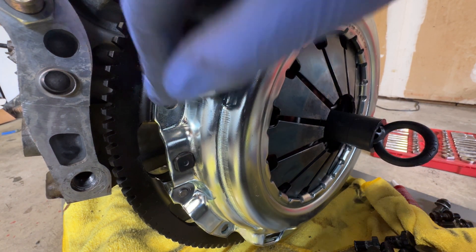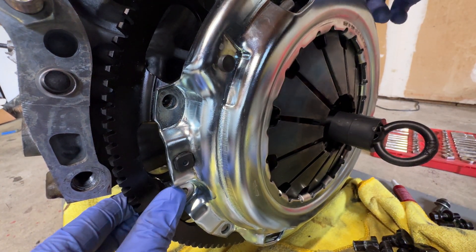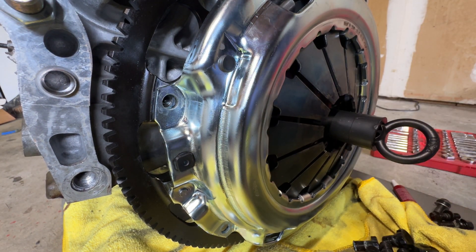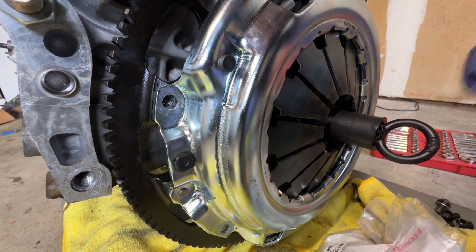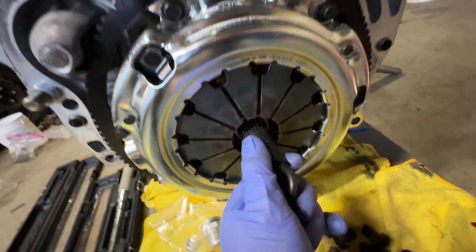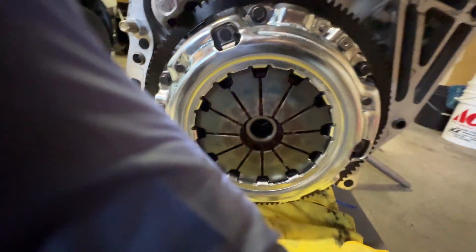It's sitting flush with the pins — sometimes it's a little tight to get on so you just have to torque it down for it to slide all the way on. With these bolts I'm going to set it to 20 foot-pounds and use a little bit of blue Loctite. All the pressure plate bolts are torqued down. You can take the alignment tool out now since the pressure plate is clamping on the clutch disc — and that's ready for the transmission to bolt onto.